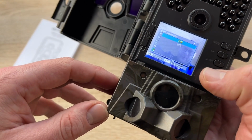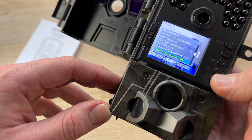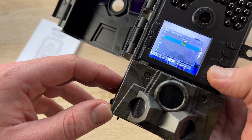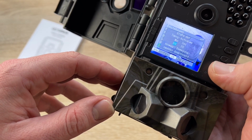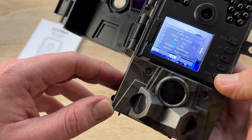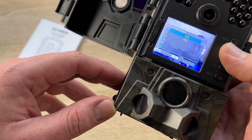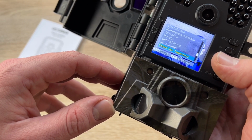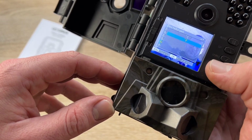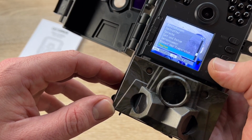Or we choose the external power supply, if it is available. The external power supply is output 6 volt 2 ampere. The DC in plug size is an external power supply plug size with 3.5 mm to 1.35 mm. You can buy this in the aftermarket. And then you can use that as power supply for indoor. And that's cool, because then you will not need any battery.